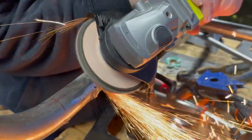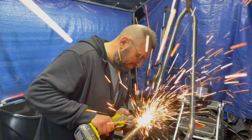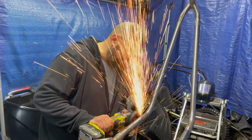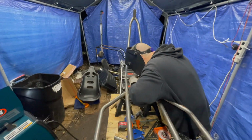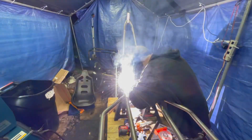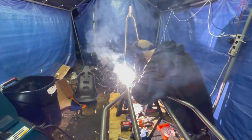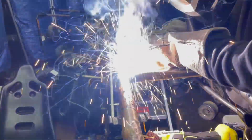And of course, at my skill level with welding, that means a whole lot of grinding to get ready to paint and look purty. By the end of the day, we had laid out the original frame, tack welded it, put the seat, fork, and engine where they belong for a full mock-up, then decided it wasn't long enough and inserted 8 inches of pipe. Yeah, bottom line is we had a very full day, which led to this full episode.